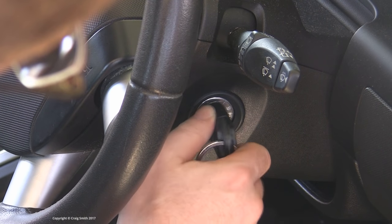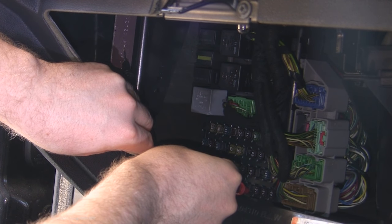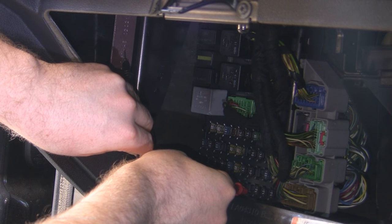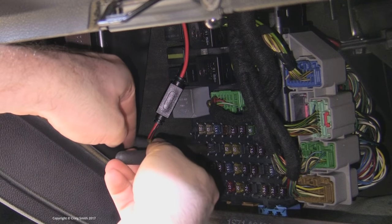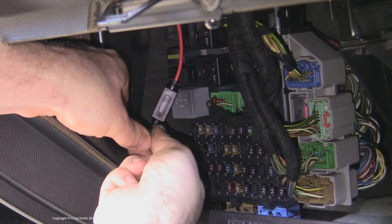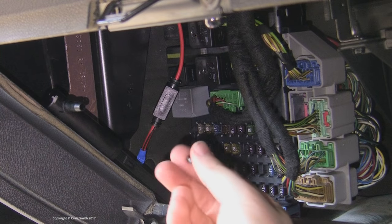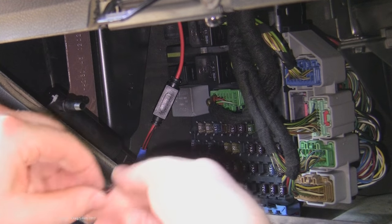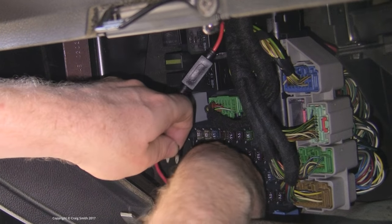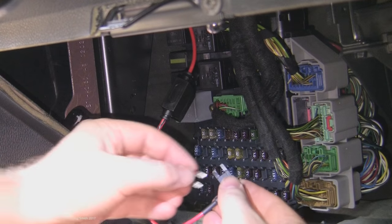There is also the accessory circuit, which usually has at least one fuse relating to the audio head unit. You can poke around with a voltmeter to find those, or look up the car's fuse diagrams, or get advice from somebody who knows the car. In my case I tracked down the accessory fuse for the head unit, because I wanted the dashcam to be operating when the ignition was turned to the accessory or ACC position, rather than requiring the engine to be running. This allows you to kill the engine yet keep recording if and when you want.